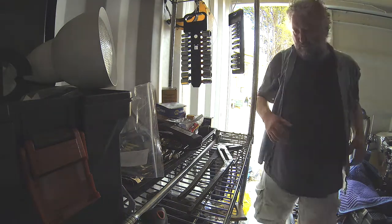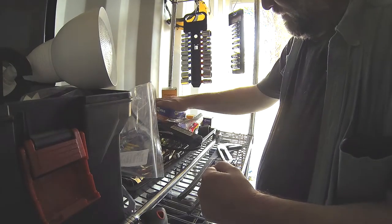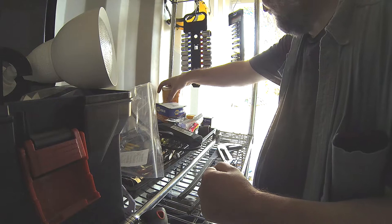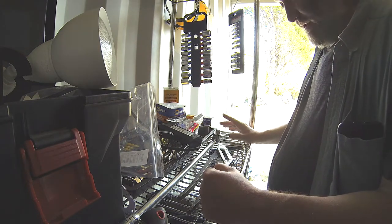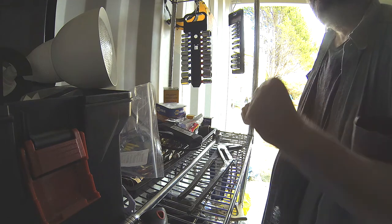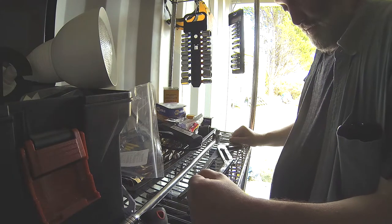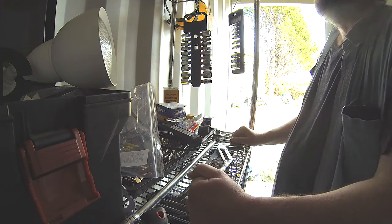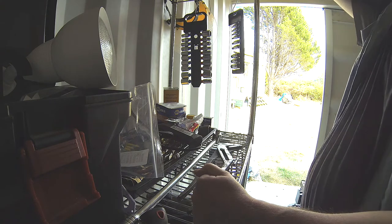Alright. These parts represent the top side of the distributor and the creation of proper spark, and that's exactly what we need. Also, during this time I'm going to have to look for my good wire, my really good butt connectors, and soldering iron. Because in addition to these parts, there was some shitty wiring inside the distributor — one of them had been taped before, and if I take that tape off, I'm almost willing to bet there's nothing holding that connection together. So yeah, that'll be good.